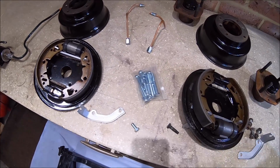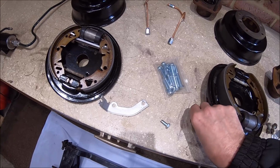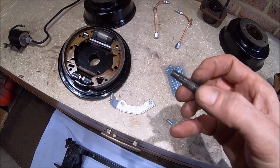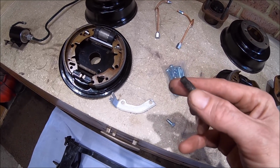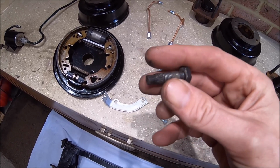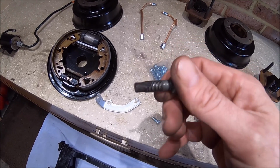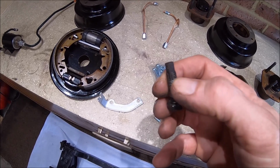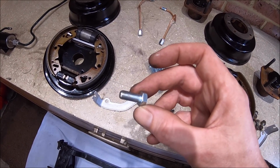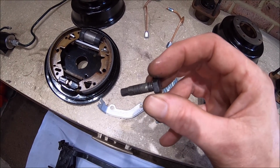So when it comes to fitting the new bolts on, this style one, because it's a new thread, I was really struggling to get them in. Luckily though, I had some bolts left over from the PL subframe because I fitted stainless ones on that. These are the ones that come with it, so they're brand new. But they have a shoulder on them, and they've also got a cut out of them, a quarter of the way up the thread, and that allows it to cut and make its own thread, or where the thread's really rough anyway, that lets it recut the thread. So those, I didn't like them. I managed to get about 3 out of 8 of them in, and then after that I wasn't going to muck about, so I just used these ones and they're going absolutely fine.